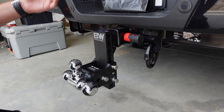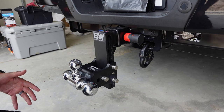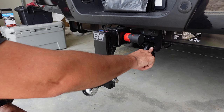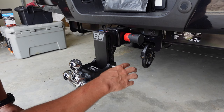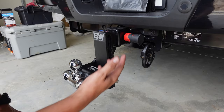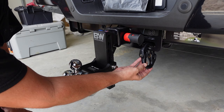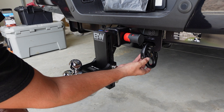Now let's talk about a few of these accessories. One major upgrade I made was adding these hammer lock links here. Any of you Ford guys are going to know what I'm talking about — those oval shaped holes that Ford gives you to attach your trailer chains to is a huge pain in the butt. Depending on the size of the hook, it can be really hard to get those hooked in. These hammer lock links make it super easy to latch your trailer chains on, and each link is rated for 12,000 pounds.